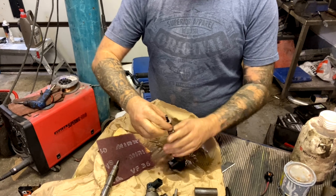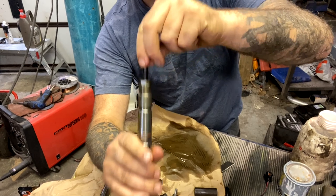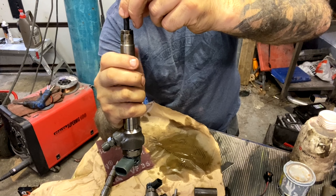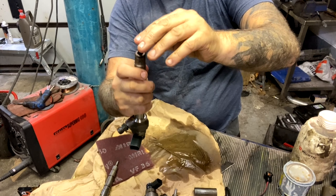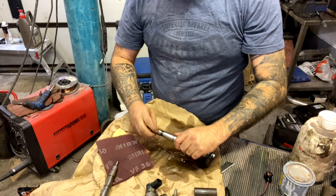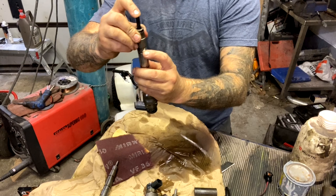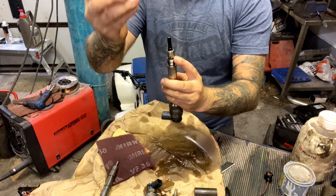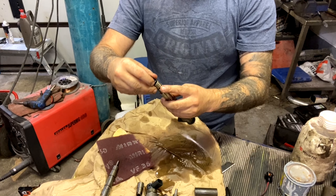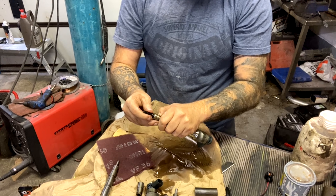This is the one we've taken to bits. Normally you have to hold the pintle down when you strip these for the first time — hold the pintle and the nut just spins. Obviously you need to go the opposite way because it's an opposite thread. In the majority of diesel injectors we get, you take that top off — that's basically like a locking cap that holds everything under tension. What you have is this outer body and a pintle — like a needle — inside.